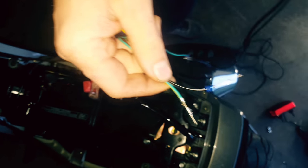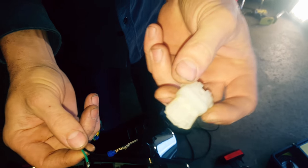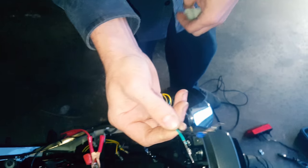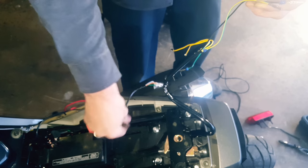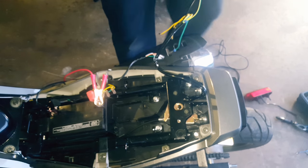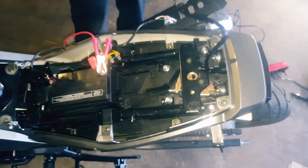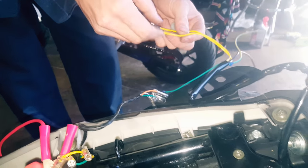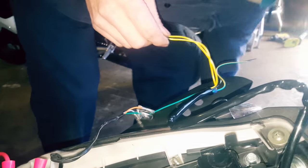You notice it has actual terminals in here that won't plug into these — that's because this connector is for the Grom, it's supposed to plug into the Grom's wiring harness. My light came with this already on so I had to snip it off and make my own ends. What we're going to do is cut them off and solder them on. Actually this wiring harness — the running light harness — we're going to use both of those because they'll just plug right in.